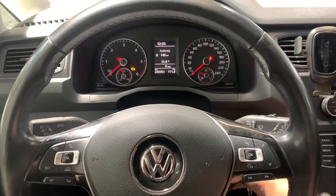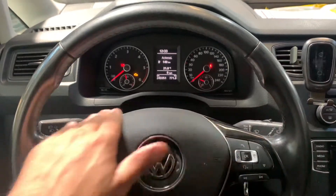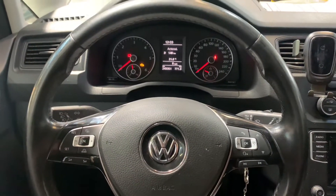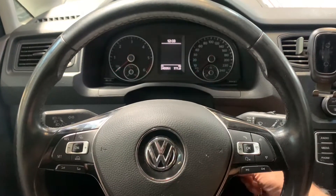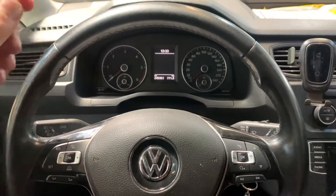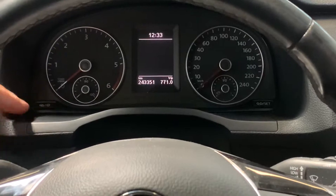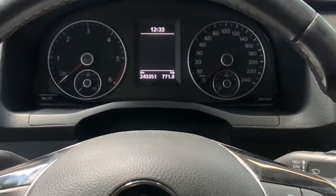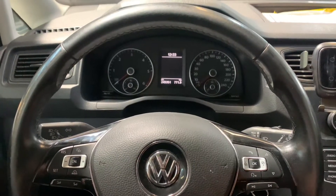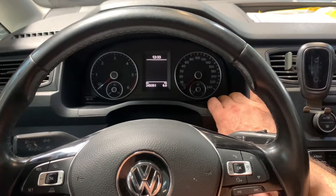Okay, first of all, this is the one with the steering wheel buttons on it, so this is slightly different than my previous video — that was an older model. First of all, turn the ignition off. Then you have two buttons over here: this button and this button. The right one is the Set button — we're going to use that first. Press the Set button, and while pressing it, turn the ignition on.